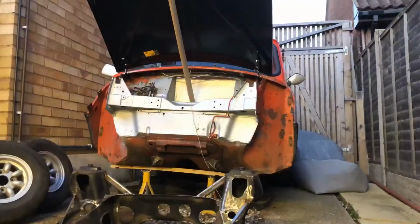broken. I'm going to get the other subframe here now with the level, level it up, and then see how level the front of that is before I even bother putting it in, because it could be the same thing with that. It could be that actually I've ended up with two twisted subframes. So yeah, just give us a minute on that one. Let's get the other one swapped over.